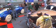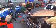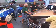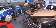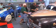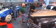I have a fairly new article up on the forum about some of the paints that come out on a Mercedes-Benz. They're called ceramic clear. Oh yeah, I've heard that. The article talks about how those nanoparticles, when they spray that paint, kind of migrate to the top, and you don't want a detailer working on it with an aggressive compound. He'll actually abrade all that stuff off. The clear coat's still there, but the thing that makes it magical is now gone. So what I always tell guys is the best detailers hang out on forums like ours, because that's where all the information gets shared. If you're just out buffing cars in the garage, you don't get any of the new information.